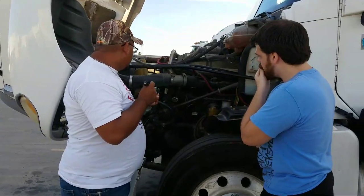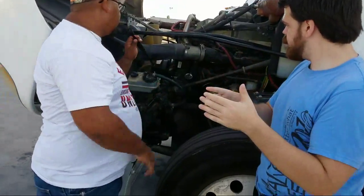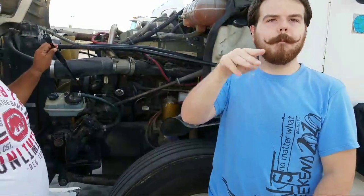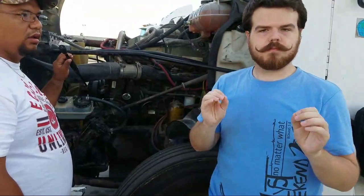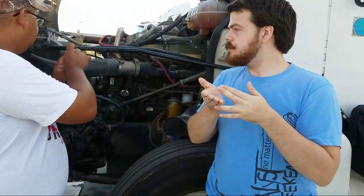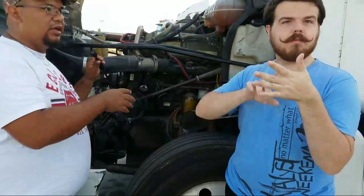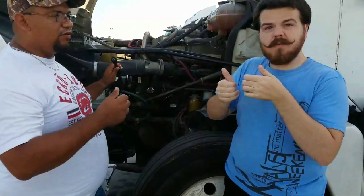Okay, from there, guys, we will go to our power steering pump. The power steering pump must be properly mounted, not cracked, bent, or broken. Now, since power steering fluid flows inside it, you must check it for leaks. So anything that has fluid running through it, like a metal component, must be checked for leaks. The same way I inspected that metal component is the exact same way you're going to inspect everything on the vehicle. Every metal component that has fluid or air, like the air compressor, make sure you check it the exact same way.